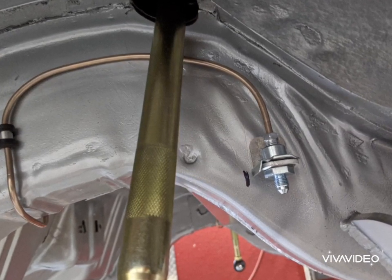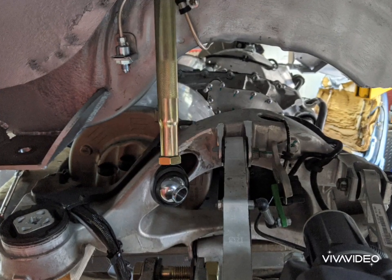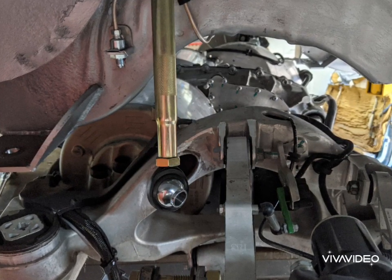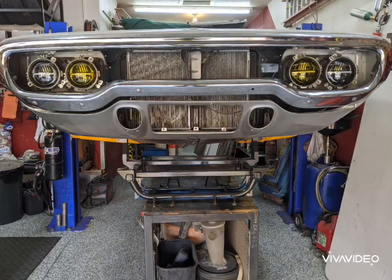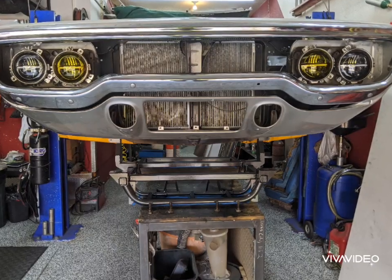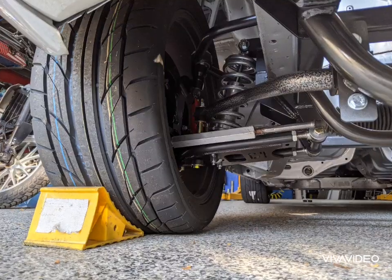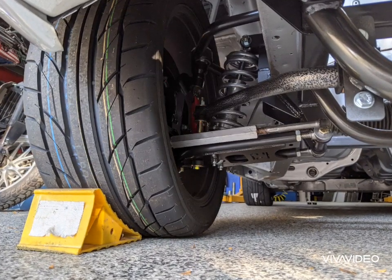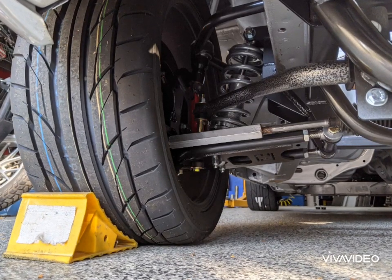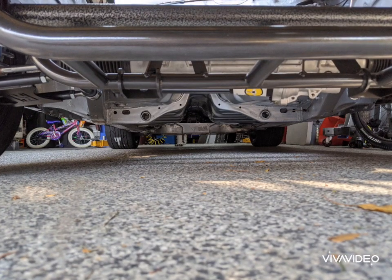This whole reassembly comes out really easy right now — four mounting points, two of the push rods for the suspension, and it's out. It will be a little more difficult once the cooling lines are hooked up. With everything finished on the brakes and the paint cured, I went ahead and reassembled the entire front end. The K-member went back in, finished the suspension with the power steering rack, the sway bar — everything's Loctite-ed and torqued, and finally it's all assembled.